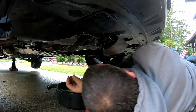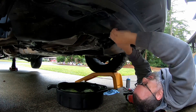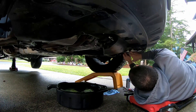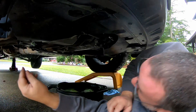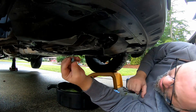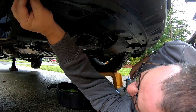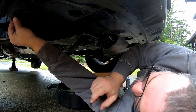Any of these bolts that have a shoulder on them are there to keep you from squashing the plastic to death when you put these back in. Make sure it is not going to cookie-cut the plastic — you want to make sure it's seated properly before torquing it up, or it'll tear the plastic up even worse than if the shoulder wasn't there. Just some small little details.